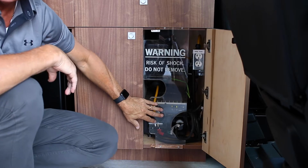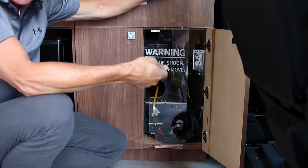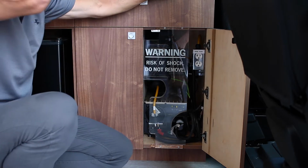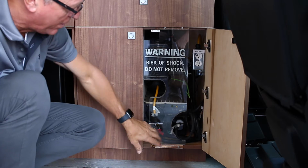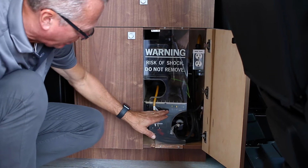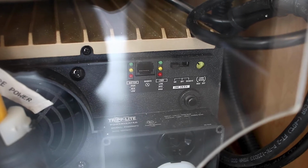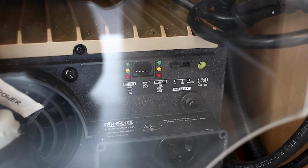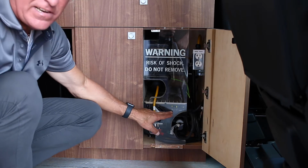If you're boondocking and you do not have shore power, you can start the van. That'll give it enough power in order to kick the AC in, and it just came on, which is good. What we're looking for here, now the AC is plugged into the inverter. There's a bunch of lights on this inverter, and the green is really, really good. Yellow means we're consuming power. When we get down to the red, that's starting to get into an area of